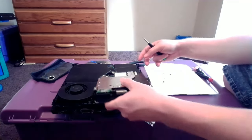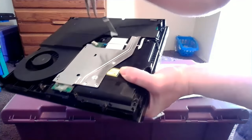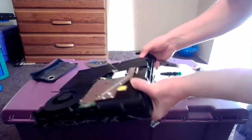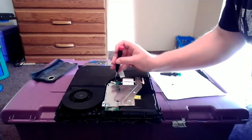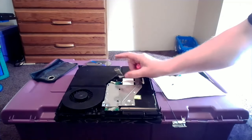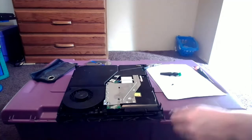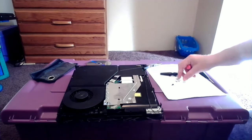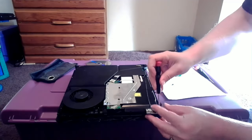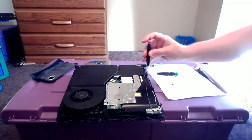We're just going to rinse and repeat — go backwards, rewind, put everything back together, put our drive down in there. We've got the screws back in. Go ahead and grab your needle-nose pliers again, and just as gently as you pulled the wiring harness out, you're going to gently put it back in — be very careful with that. You've kind of got to guide it in there, then take your driver and put that bottom screw back down in there. That can be a little tricky as well, but you'll get it. Then just take your ribbon and push it right back up into that casing until you hear a click. Give it a little tug just to make sure it's in there. Then throw your Wi-Fi cable back on and get the rest of these screws back on, and get that screw back on back there.